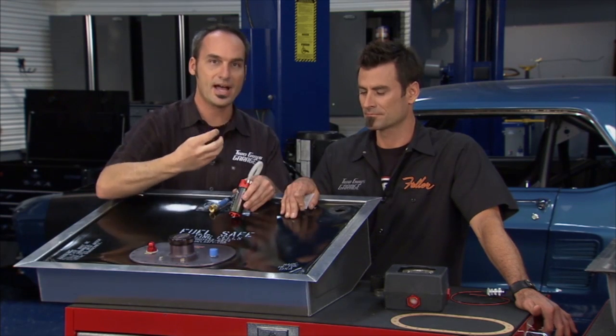The reason is you're pulling a vacuum to get fuel from the tank through the pickup to the pump. From there it's not a problem — you're pushing, building pressure to go forward. But pulling that vacuum lowers the pressure, lowers the boiling point, so you're going to cavitate and vaporize much sooner. Also, on return-style fuel systems, you're sending a lot of fuel to the front ready for wide-open throttle, but when you're not at WOT, that fuel returns already warmed up. It's getting heat off the pavement too, so you're getting closer to that boiling point from the other direction. Cavitation is a real easy thing to do.